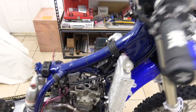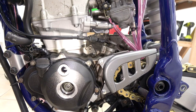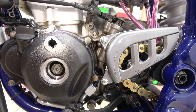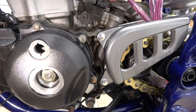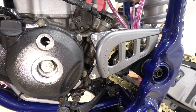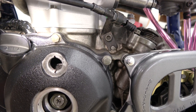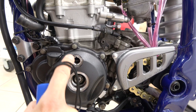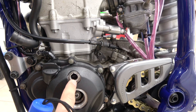Now we're going to go back on the other side. I'll take my flashlight here. I'm already on top dead center but with a little bit of light I'm going to be able to show you. You want to pay attention to that notch right here and the notch on the rotor of the ignition inside. There is not only one mark on that rotor — there is an 'H' right there. On the rotor inside there is 'HI', like high, so that means on top, and that's the 'I' of 'HI' that needs to be lined up with that notch.